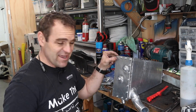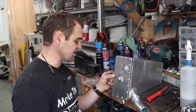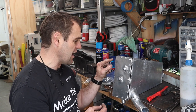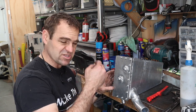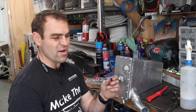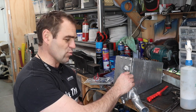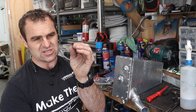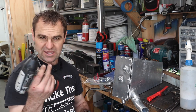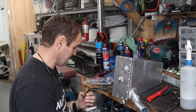Now that I've actually got the extra thickness of having this rubber in here — I'll probably have a thinner piece of rubber when I actually get to it — the bolts are now sort of interfering with the body of the car. I'm going to swap them over — it was always the plan. I had these normal bolts to start with. I'm going to change them over to these countersunk Allen head bolts. So I'm just going to run through with the countersink bit now on all these holes and put in some countersunk heads.